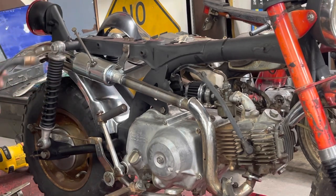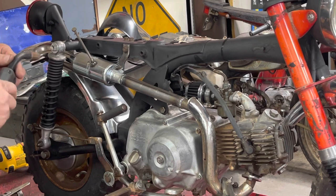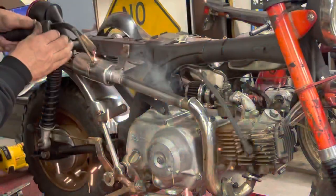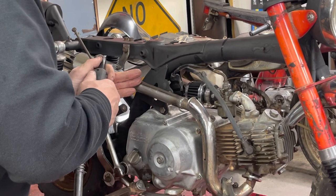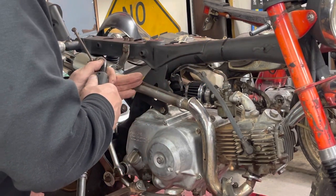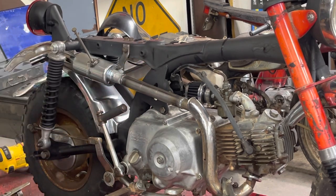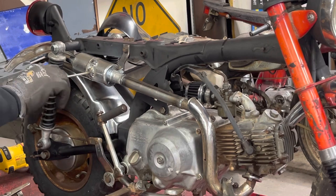What I'm trying to do is start the arc on the nut, which is thicker, so I'm not worried about burning through it, and then try and fade it over into the thinner sheet metal. That's how I do it anyway. Not saying that's right. Sorry, I'm gonna be in your way. Okay, you get the idea. I'm gonna do that to the other one, and then when I get ready to bolt the shield on there, I'll bring you back. It's definitely not pretty by any stretch, but I think I have them on there now.